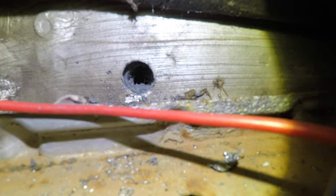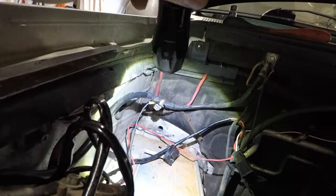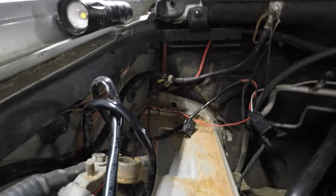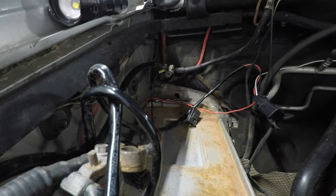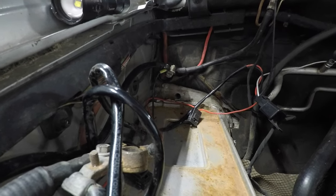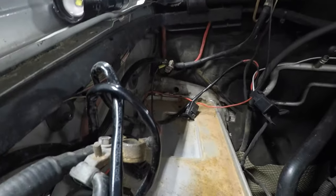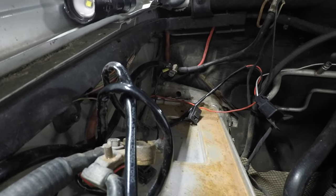The idea I was talking about before — using tubing and slicing it down the middle — I'm going to nix that. Instead, I'm going to use a piece of tubing, vacuum line or whatever, and just push it straight through. That way I've got a reliable pass-through for today and in the future. The firewall is just too thick, the hole's not big enough, and I don't want to waller it out any more than necessary. I'll find a piece of old tubing — vacuum line, cooling line, anything that keeps the wires from getting cut on the metal and shorting out.